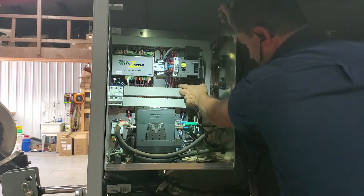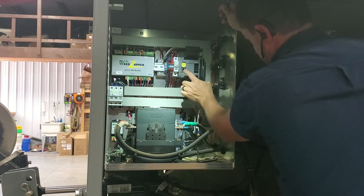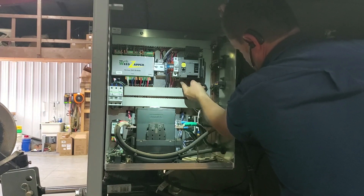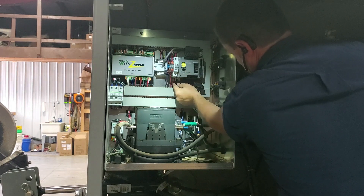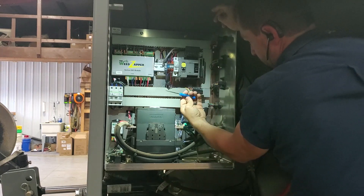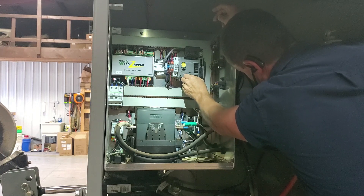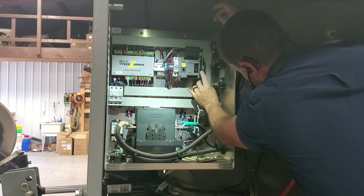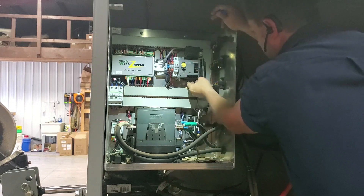Now this one here is a little different — you see two wires. These are actually our power wires: one is blue, one is black, and they're taking power to our computer. There's a little plastic shield right here. I'm going to hook my finger in behind it and pull forward — the wires eject when that happens. Those are out now. Back to my small screwdriver. There's a little d-ring, black in color, back against the inside panel. I pull down — hear it click. There's a second one below the expansion module; pull down until I hear it click. My computer is now free.